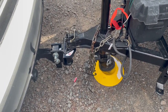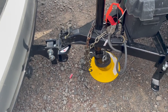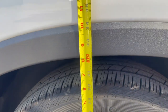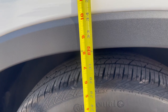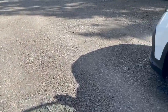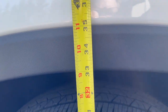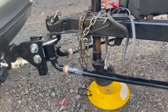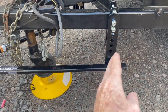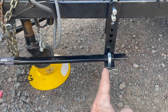We've successfully hitched the camper up to the Honda. I'm going to take all the weight off that front dolly wheel and do some measurements before I put on the bars. On our rear wheel, we're down to about 32 inches — so it dropped about an inch. On the front wheels, we're at 33 inches even. I have the bars on now. To get them on, I adjusted them — remember we originally put these fasteners on using those other two holes. There was no way I could get those bars on, so I had to drop them all the way down for my setup. You can see the front wheels are up off the ground and the little pinwheel is up off the ground as well.